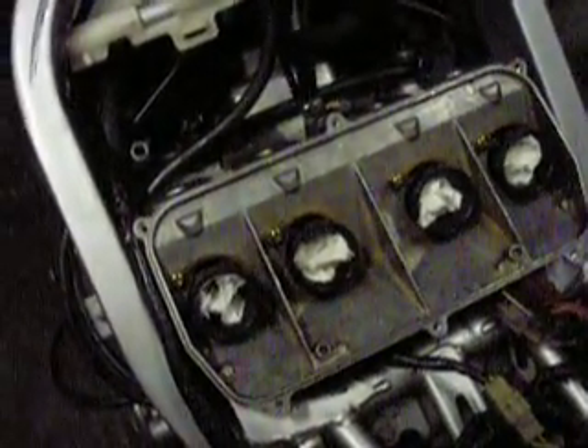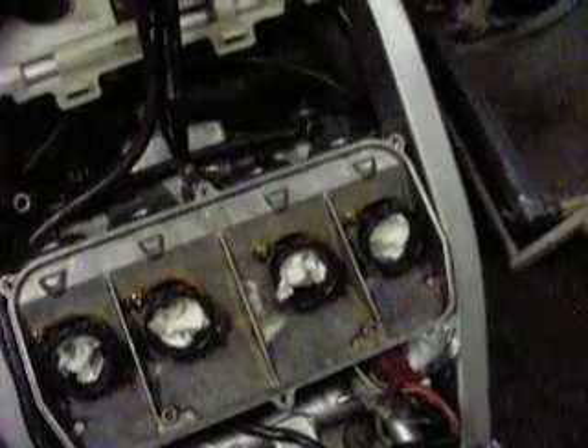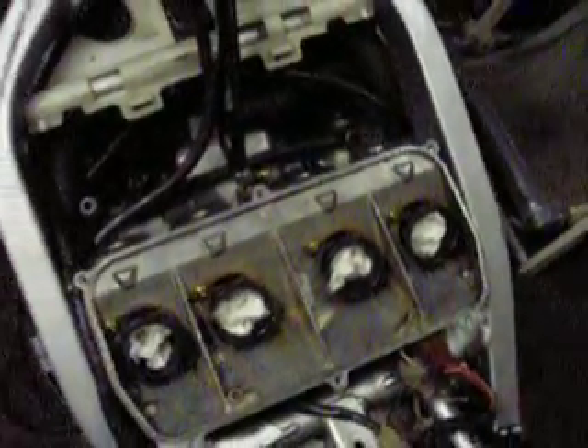Start the carbs evenly into the intake holes and put rags down to protect your hands. If it won't go in, you can usually get the first carb started and get that one in the hole. Then, using your own judgment, put paper towel in the intake holes and you can stomp the carburetors in — like this. But use your own discretion; it's your machine, if you break it that's your fault.